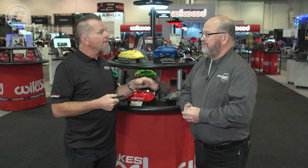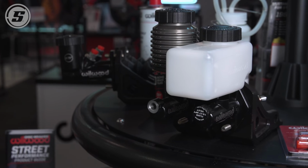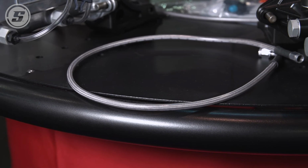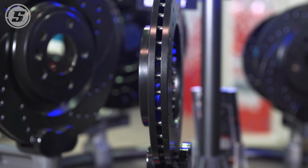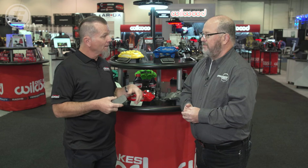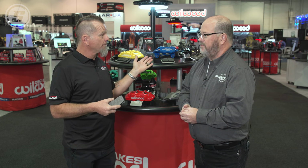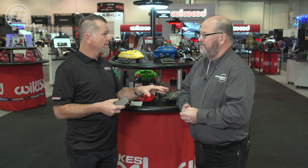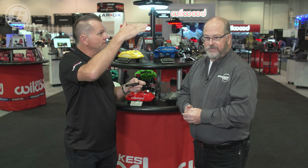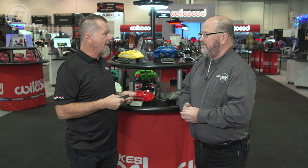After that, you'll typically exit the vehicle, leave it parked, and check all 4 corners to make sure you have no leaks. Make sure the rotors are the same temperature, and feel the outside of the wheel to make sure they all have the same temperature. If all those things look great, drive it slowly back to your shop or home using a minimal amount of brake. That starts to cool down the system nice and gently. Park it and let the brakes cool back down to ambient.